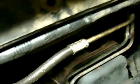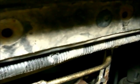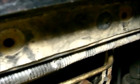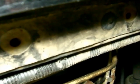Alright, before any of this work can actually be completed, or even started for that matter, you have a plastic guard underneath where the oil filter access door is. And right now you can see I took that out. It's very easy to take out. I saw some conflicting things on a couple of the posts saying they're really hard to get out. All they are is little rubber grommets that can be pulled out. They could be pried off. What I used was a pliers with a 90-degree angle, wedged it in underneath, and just pulled straight down, and they popped out. None of them broke, so I'll be able to reuse them.